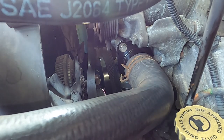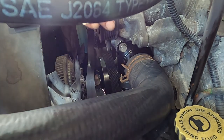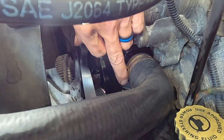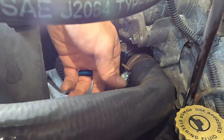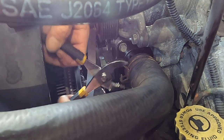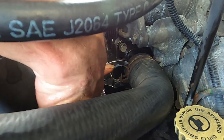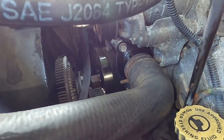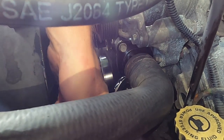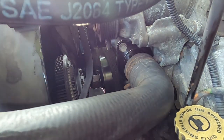My tip is: you see where this clamp is right here? If you leave it there, your belt runs right next to it — so every time you torque that engine you take a chance of hitting that clip and breaking your belt. I've come to realize with these trucks, these third-gen Hemi Rams, you have to kind of fight it but you need to get your clamp to roll down underneath, which clears that belt a lot more.